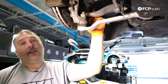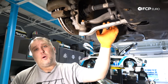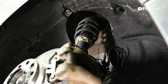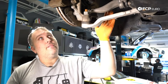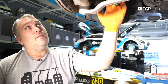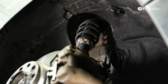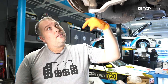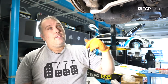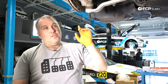At the top of the car, the top strut mount — BMW has two variations: a five-bolt top and a three-bolt top. Earlier production cars are a three-bolt top; later production is a five-bolt. This particular vehicle has a three-bolt and also has aftermarket coilovers. For anybody replacing the front struts and putting new strut mounts on, the strut mounts do not come from BMW threaded. Traditionally they used studs, but BMW has now gone over to using bolts. Those bolt holes are not threaded — the fasteners used are self-tapping and make their own threads. So if you get a strut mount and see no threads cut in, that's totally normal.